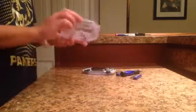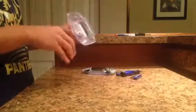Okay. So we'll start with this, the bottom half actually, and if you look, the only other thing in here when you take it apart besides this piece of plastic is a piece of metal right here, and upon looking at it, I can't see that there's any electronics in it. There are 4 little Phillips head screws. If you really want to take this off to clean it more in depth, you certainly can. But I'm going to leave this in and just clean this whole thing how it is, because it doesn't look like this really needs taken off because of water issues.